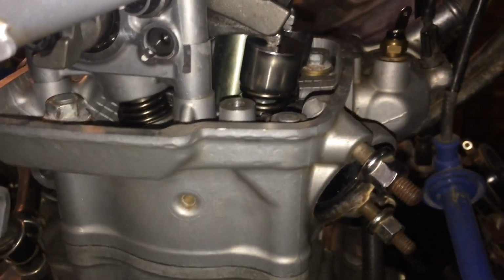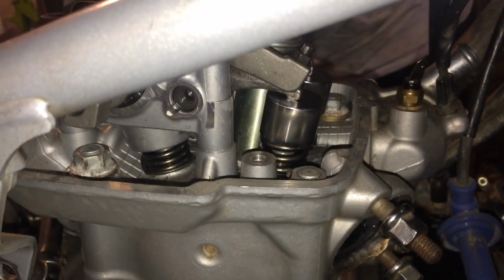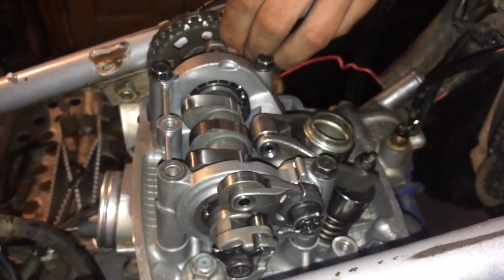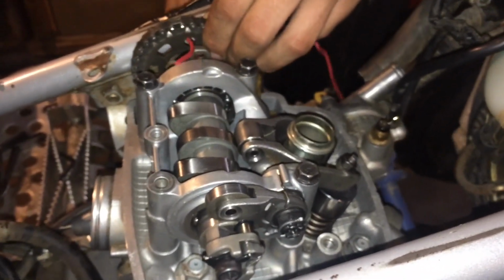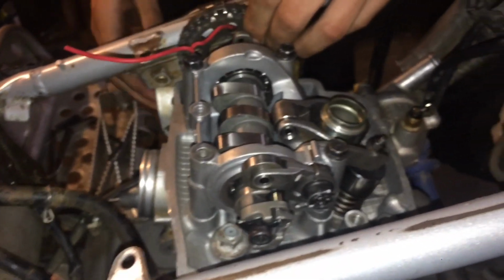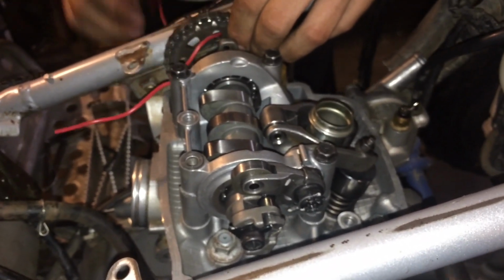So we're gonna skip another size. What were we at just now? 165, I think, on the exhaust. Yeah, so we're gonna move down to 155. I think I'm gonna jump way down again because we still got room. Yeah, I'm probably gonna jump down to like a 140. Might as well jump down a few more steps than have to go down 3 at a time.